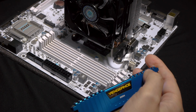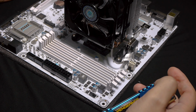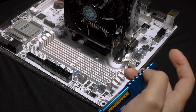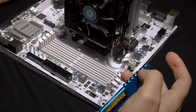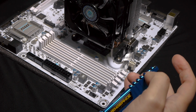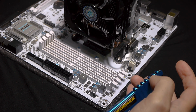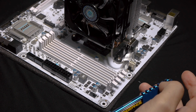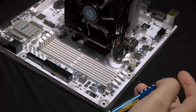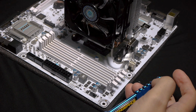But for that, you need to go and update your BIOS before you install Windows. And I say this is very important. Go and update manually from a USB key your BIOS on the motherboard before you install Windows. To do that, take a USB key formatted. I think it's FAT32 for the BIOS that it has to be formatted. Formatted, put the BIOS in, only the BIOS, nothing else. Go to the BIOS, go to the menu, go to upgrade it manually from there,